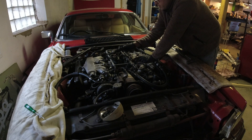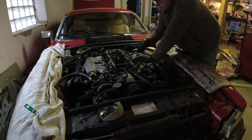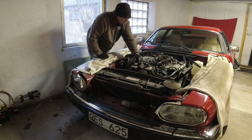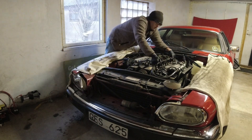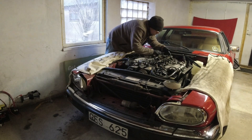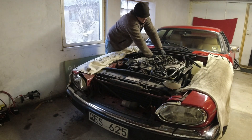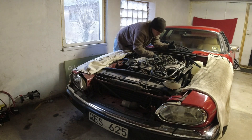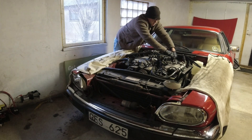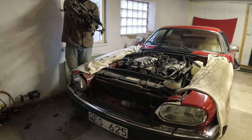I'll get that line off, and then it's just the nuts on this side. There were zip ties on this side for the wiring, so get those off and the fuel rail will lift off. The last thing is to crack off this fuel line here, and then the whole thing should lift out of place. Sometimes the injectors like to stick a little bit in the inlet, but a couple of tugs and — big fuel spill there. Hold your finger over it, move it away so you can dispose of the fuel. And now: one fuel rail removed.